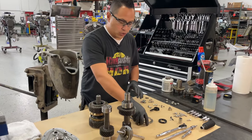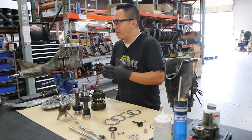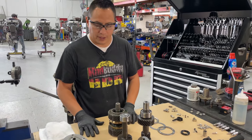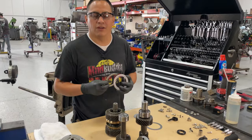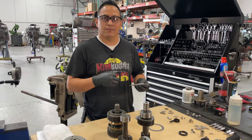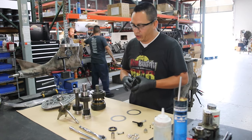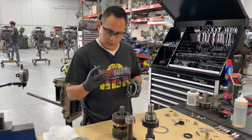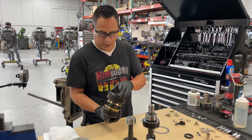First of all, you do want to make sure the surface that you're working on is very clean, and the reason for that is you're dealing with bearings. Right now I have a brand new sheet of wrapping paper that I found. There is no dust, there is nothing. Just like with all bearings, you want a very clean area, because you don't want anything getting in there and scarring them, making marks, or making weird noises that you could have prevented by keeping everything clean. So these little bearings, the thrust bearings, they go on the clutch part, top and bottom, right there.